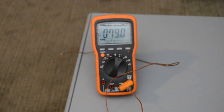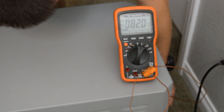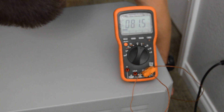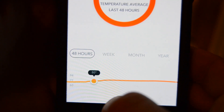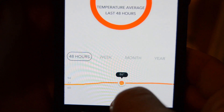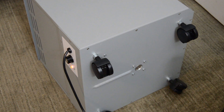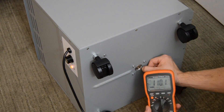Next, I wanted to know how much heat was added to the room from the filter motor. I took temperature readings on the intake and outlet and found about a 3 degree rise in air temperature, which is not too bad. But if you were to run this in a small room with little to no ventilation, you'd notice the temperature increase. When the filter was run isolated in the bathroom, it was noticeably more toasty when I opened the door, and the overall temperature increase was 11 degrees. The hottest point on the air filter turns out to be the motor mount on the bottom, with a maximum temperature of 110 degrees.